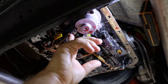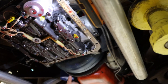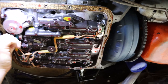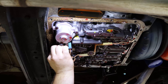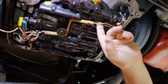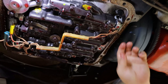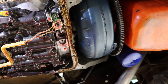As you'll see right here, we've got the fourth gear pressure switch — this is one piece we're going to be replacing. The other is the solenoid up here at the front. We're going to be replacing both of those. We're going to start by unplugging them — they just slide right off, kind of a trick to get to. We'll unplug those and then take this whole wiring harness out of the way. Then there are two bolts here and here — we're going to remove those and that solenoid will come out.